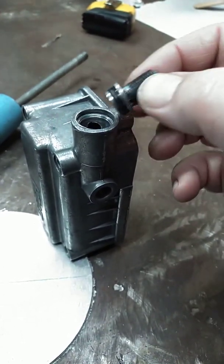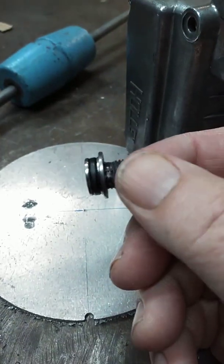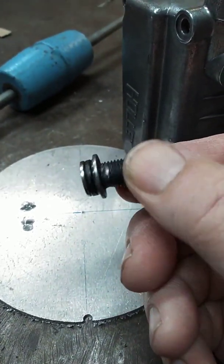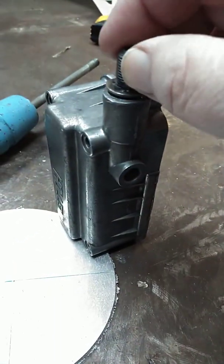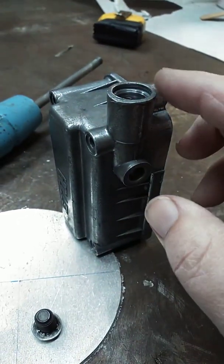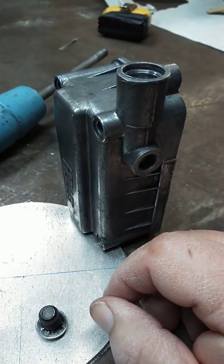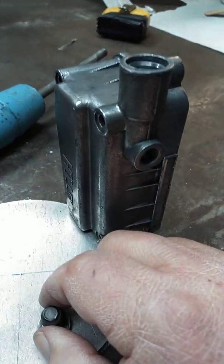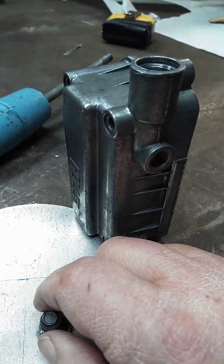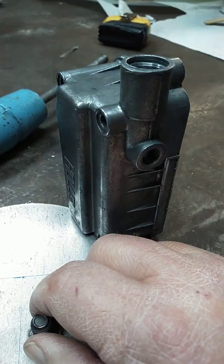So it was leaking past the o-ring and then out. I may get a neoprene o-ring, try to get it on there, pop it back in and peen the edges back over to lock it in — see if it works. But like I said, I did order a new float bowl, and by the time you get tax and shipping it was like sixty-some dollars.